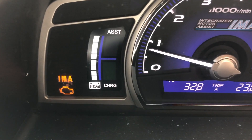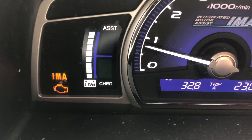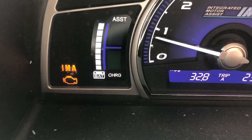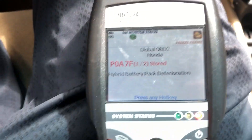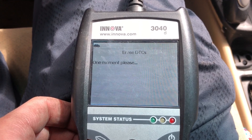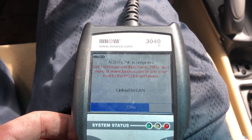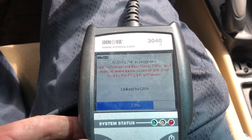I'm talking probably once every five to ten minutes. So I will show you exactly the things you can do and what works best. The first thing we're going to do is reset it to see if the light comes back on. If you don't have a scanner, unhook the engine battery, hook it back on, and turn on the vehicle.